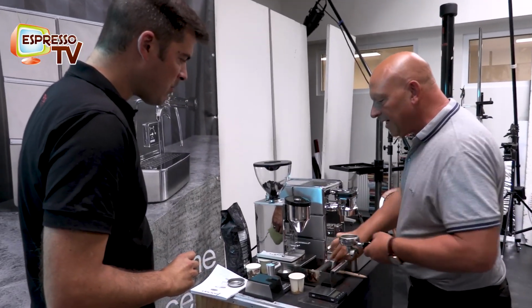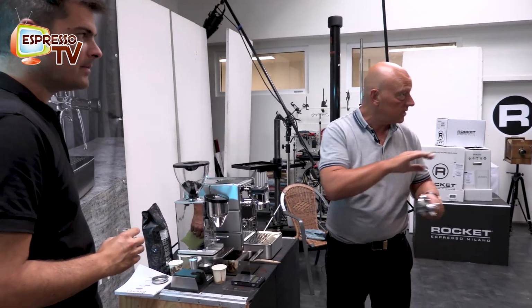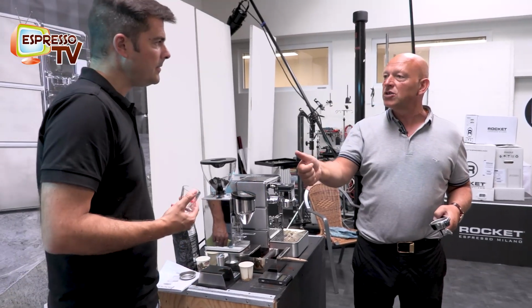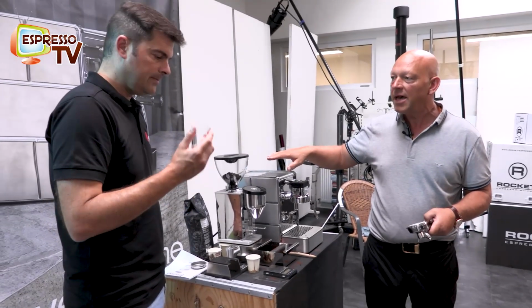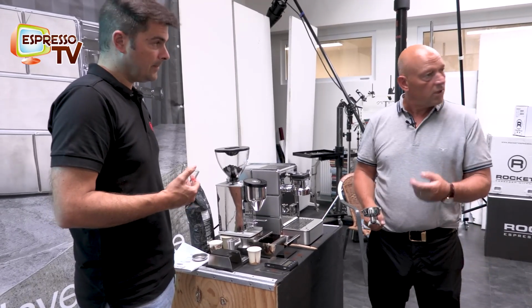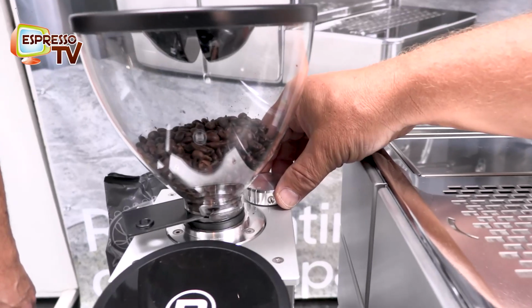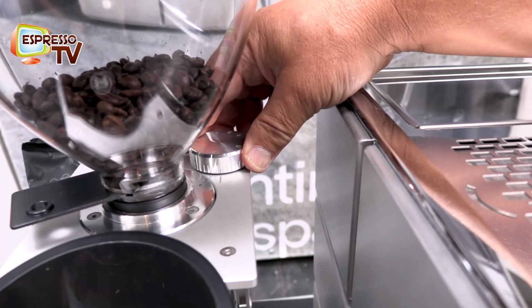So what we learn here, that the coffee itself is okay, but it's too fine, so the taste is terrible. It's too bitter, very bitter. And when it's too bitter, it's either too much coffee powder, or the burrs are already end of life. Exactly. Or really too fine. And now it's easy when you go towards coarse. So we go anti-clockwise. Yeah, exactly. In this direction.